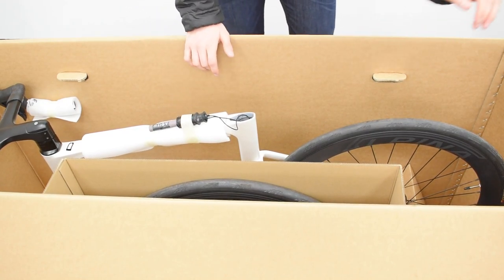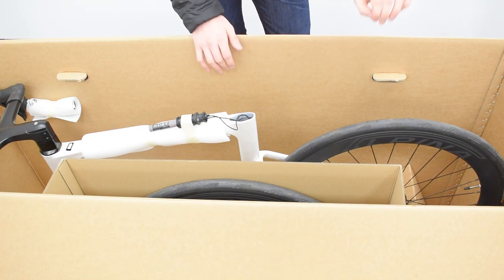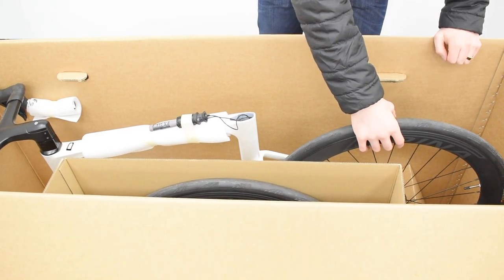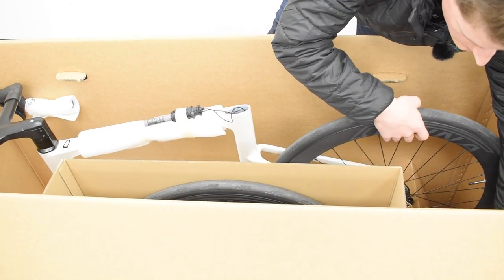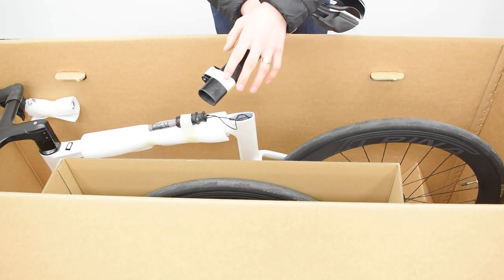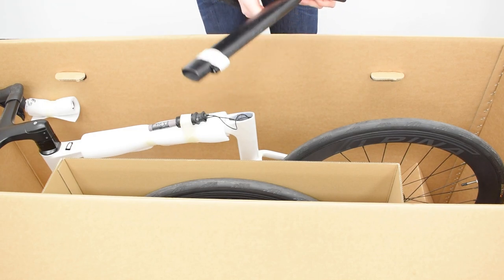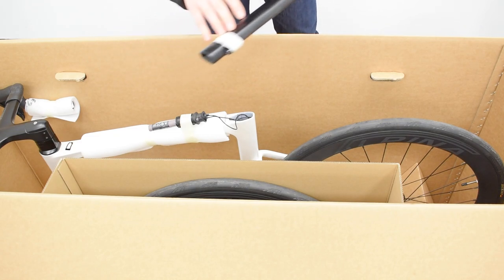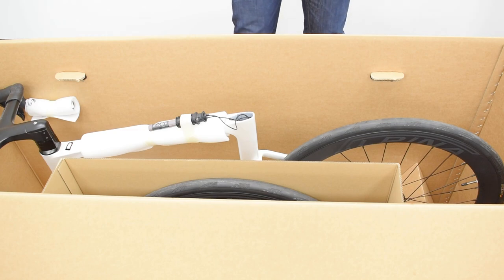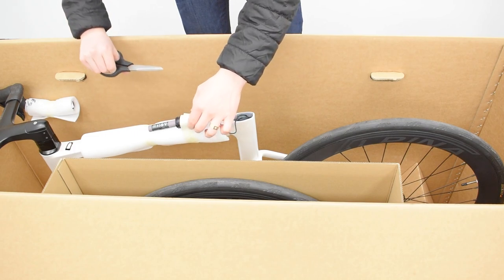I'm going to walk you through how to fit that into your seat post as well. Your Di2 battery is here, seat post is down there. First thing you're going to do is grab your seat post and pull it out from the bottom of the box — you may need to lift the back wheel up slightly for easier access. One thing you'll notice is that the seat post clamp is attached and taped to the post — leave that there for now, we're not going to need it just yet. Pop the seat post to one side, then get your scissors and cut away the tape around the battery, nice and careful.